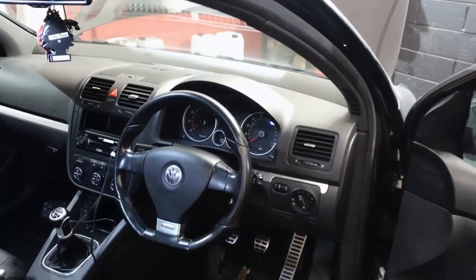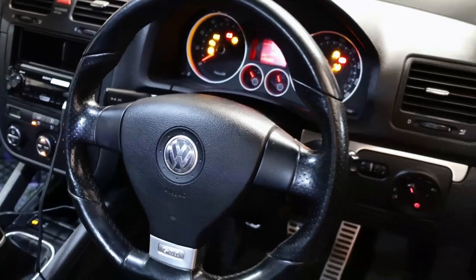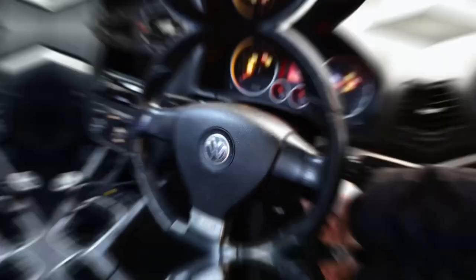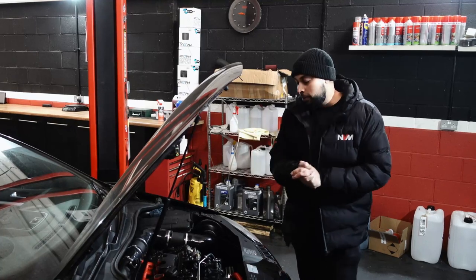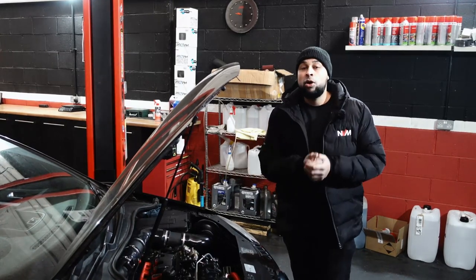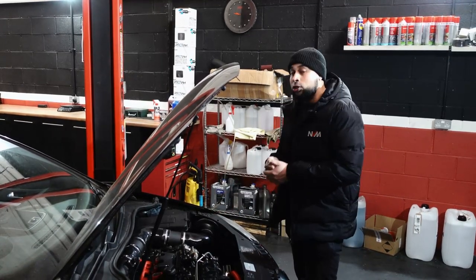All the parts necessary for a KO4 swap are now on the vehicle. We've put a base calibration on there for all the new sensors for the KO4 — but it's not firing up. Looking at the data log from the diagnostics, it looks like the fuel is backing up in the rail and the rail pressure is actually increasing even at low crank, which means the injectors are not firing and letting any fuel through. We've taken off the spark plugs and the tips are completely dry — no fuel is getting to the combustion chamber. So all of this has to come back off for another set of injectors before we start again.